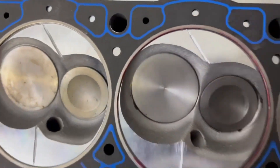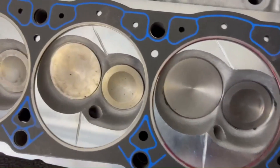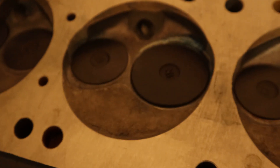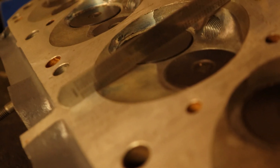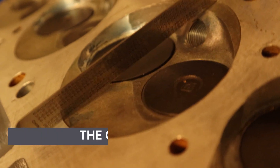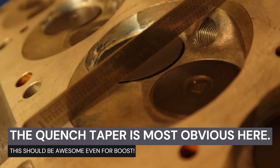That's what we're looking at — that's the way it should be. This is an example of a softened combustion chamber; note the quench area has been tapered to a wider clearance. This is the 280Z head — it's been milled 40 down. The tapering of the quench side, or softening of the head, is very effective here.